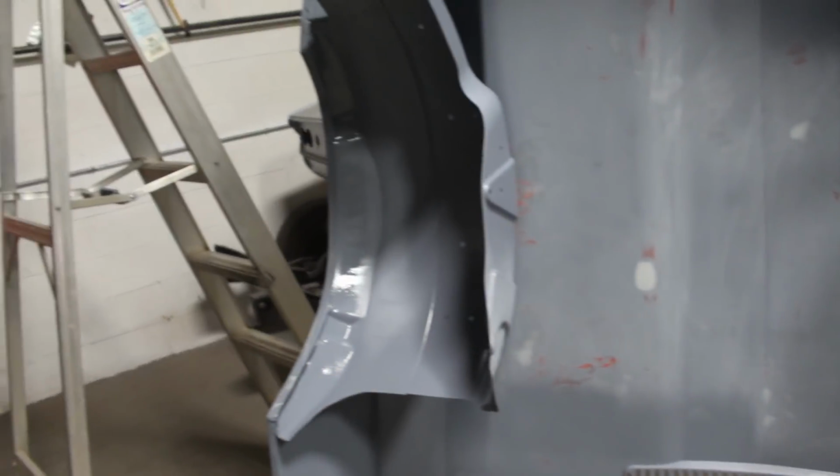I'll tell you what we're gonna do. So, the outside of the bonnet, the exterior is sprayed completely. I wanted to go ahead and spray a full coat of epoxy on the outside. On the inside, I left some areas not sprayed, but all the bare metal is covered, so that's, like I said, that was the point of the entire thing.